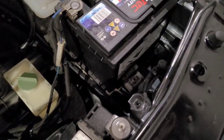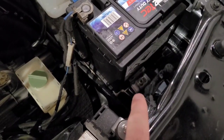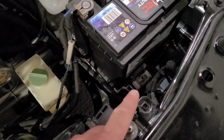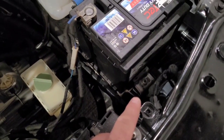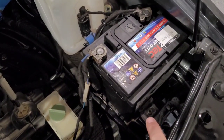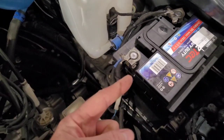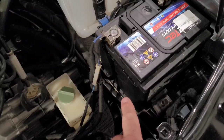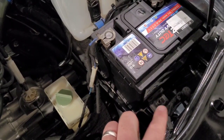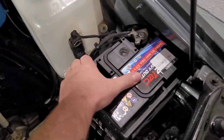The battery is bolted in, cleaned the clamp up, nice Allen head in there. I've put a bit of silicone hose underneath that clamp so when you do the clamp up tight it's not scratching the paint straight away - it's putting pressure on the battery. Because all that clamp does is go tight on there but its force is pushing the battery that way to wedge in the line down there, and then the clip just sits on the edge of the battery. So a bit of old silicone hose, just cut it in half, slightly widen the shape of that, so when that bolts down it doesn't scratch the paint but it holds it all nice and tight.